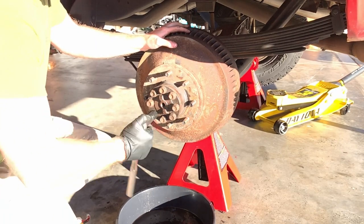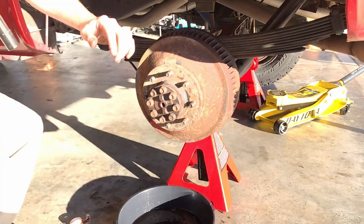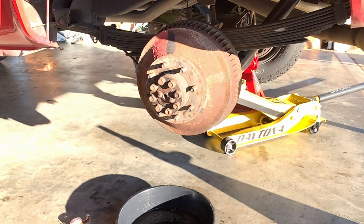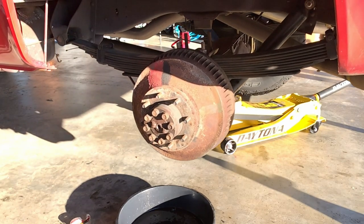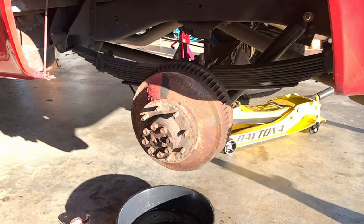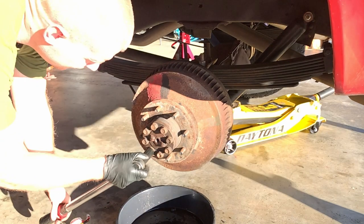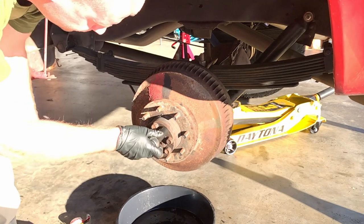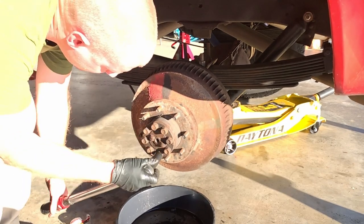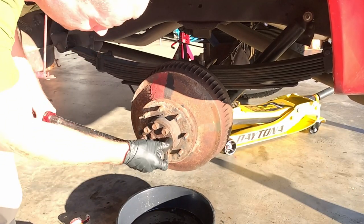Because you had to leave your vehicle in neutral so the wheels could spin, you won't be able to hold the torque back on your own. So go back and remove the jack stands after lifting the rear differential slightly, then lower it just enough so the opposite side wheel is touching the ground and providing resistance. Once that resistance is in place, you'll be able to go back and ensure proper torque on all of the bolts. Double-check the torque on the bolts at least twice all the way around at 115 foot-pounds, or 136 foot-pounds for the newer 14-bolt rear ends as indicated in your manual.